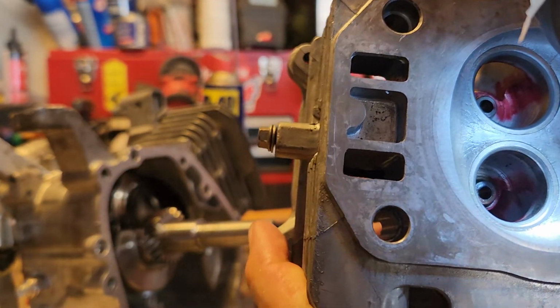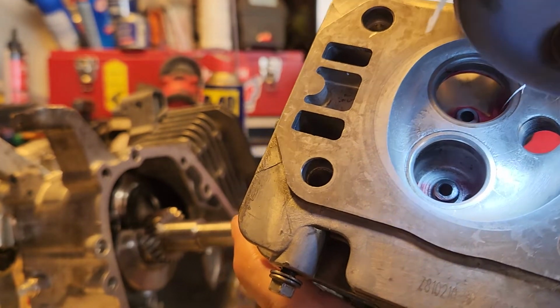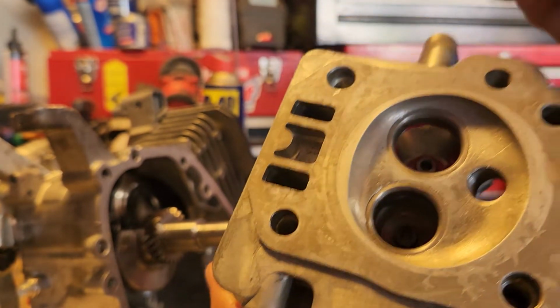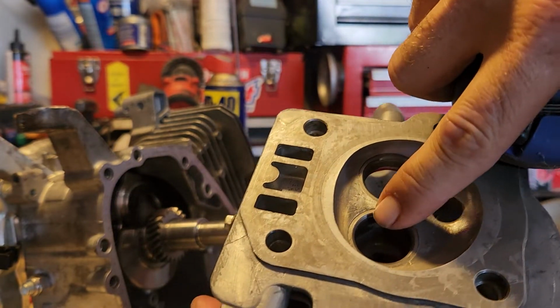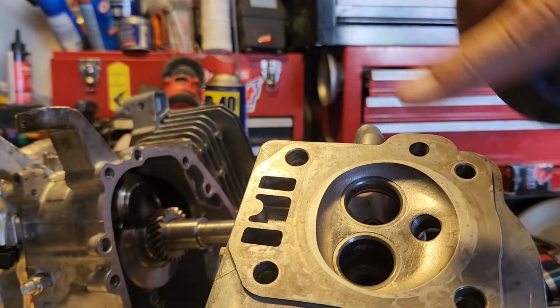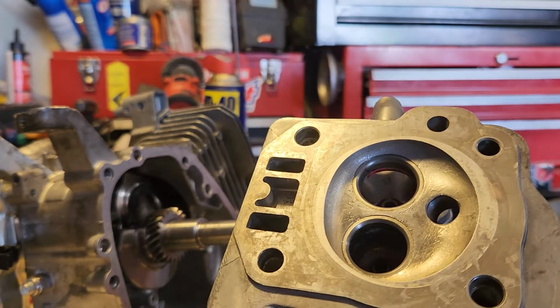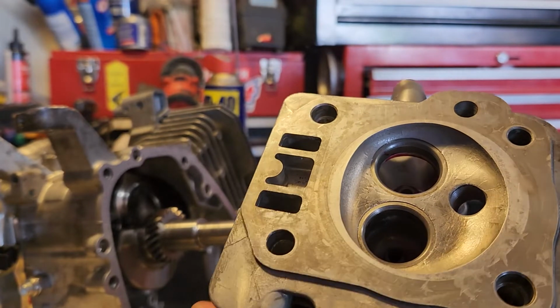And what you don't want to do is cup it to where it's like a light bulb is in there. You don't want it to go in, concave around, and then come back out right here where the valve is. You just want it to kind of flow up. You don't want the air and fuel crashing into any walls. You want it to just flow. The smoother the transformation, the better.